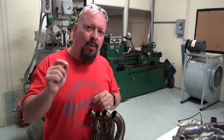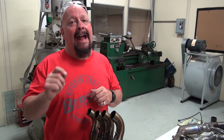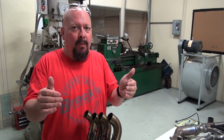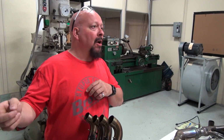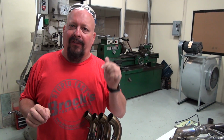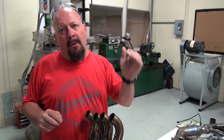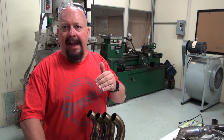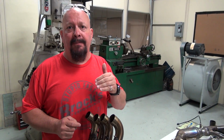Because that's the tool we're using. And what's not happening on the dyno? It's a static application, which means the bike's not moving. We're getting air in and we're getting air out, but we're not forcing air in. We're forcing air in at the drag strip. So we know we can get away with this larger diameter tubing even on that smaller engine bike.